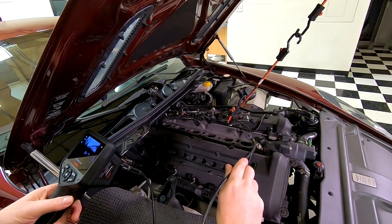If I put a little bit of a bend on the camera and get through the spark plug hole, I'm going to try to look at the cylinder wall condition. Aiming the camera over there — the piston is on the right-hand side, and the cylinder wall has that beautiful crosshatch pattern on the left. As I rotate the camera around, that crosshatch pattern is exactly what we want to see — those nice diagonal honing marks from when it was created at the factory. What would be bad news is vertical, straight up-and-down scratch marks. As the piston goes up and down, if there were ceramic particles in there, you would see these vertical lines, and that would be a sign of serious engine deterioration. This looks great.